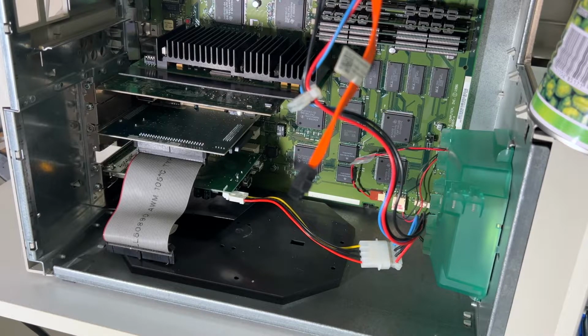On the Tsunami boards, the motherboard L2 cache is running the show, and in the case of a lot of G3 upgrades, the L2 cache will actually take over for the G3's L2 cache, and so the cache on the card will actually be kind of shuffled off as L3 cache, while the slower motherboard cache will become the actual L2 cache.